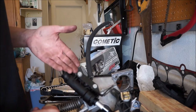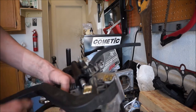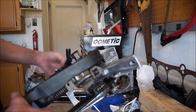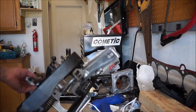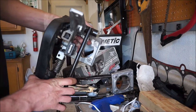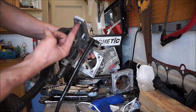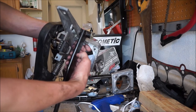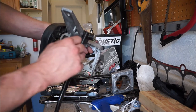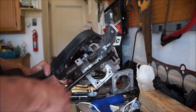After we get the rest of the pedal assembly on, we'll plug the clutch line into the master cylinder on the brake booster. For the reverse installation, it's basically the same as taking it out. Once the clutch lines are done, we start getting the housing up — four bolts on the housing first, then the upper bolt, then the clip, the spring, and plug everything in.